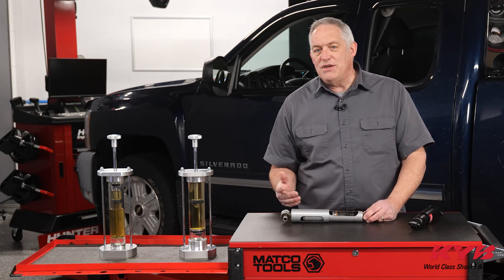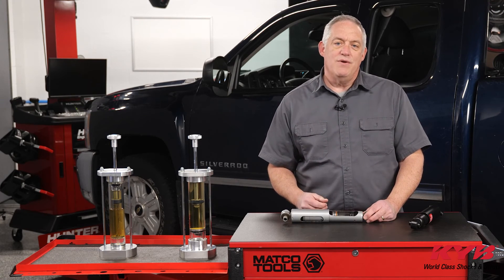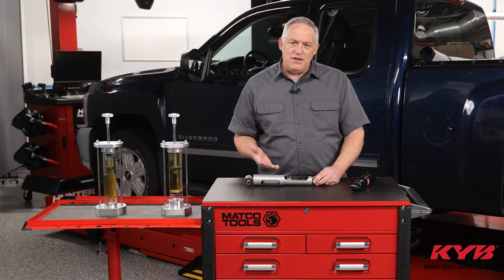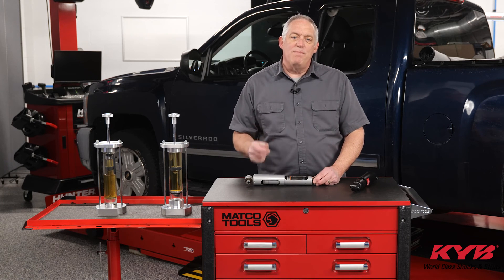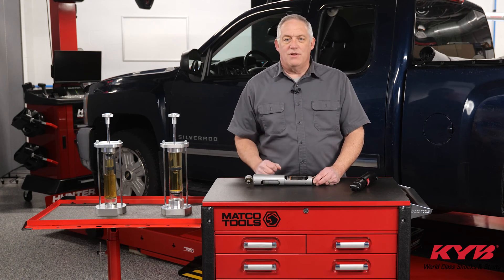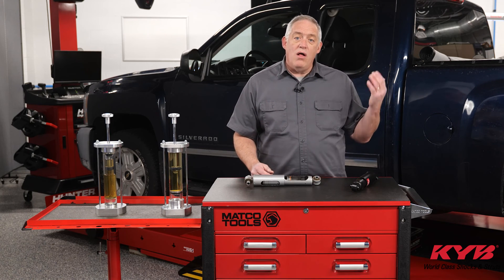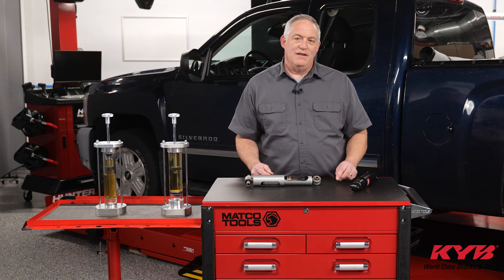You also won't see any aeration or shock fade with heavy use because it's a sealed air-free unit. So now you've seen the monotube advantages: a single cylinder, aeration-free, high gas pressure shock with an extra boost for aggressive or extra load driving. A great choice for vehicles that tow, haul, or have larger tires, or if you just want to add more handling and control.